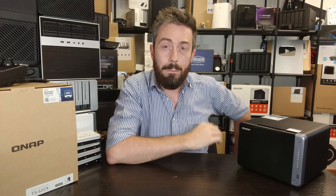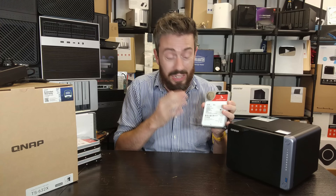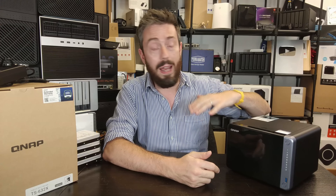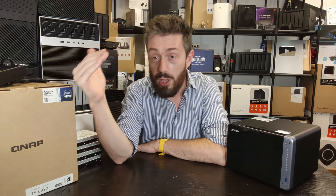Noise: when the system is in operation, as an ARM-based NAS, it's actually pretty low - especially at idle or standby. However, the storage media you choose will make a difference. When populated with those four 24TB drives - which at above 12 to 14TB these prosumer and enterprise-grade drives do creep up in noise - this generally mid-tier noise chassis went up to about 35 to 38 dBA during heavy read and writes. During idle it came down to about 28 to 29 dBA, and with the SSDs it dropped all the way down to 22 dBA.